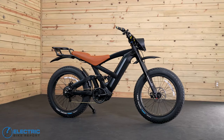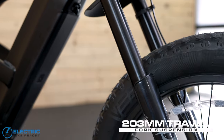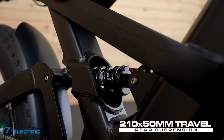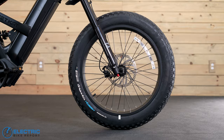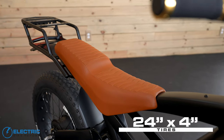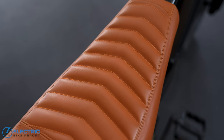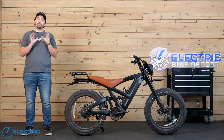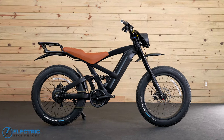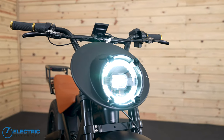First off, its comfort. There is a lot of spec here that adds up to a pretty nice riding experience. It has a full suspension design — there's an inverted KKE spring fork with a listed 203 millimeters of travel, a 210 by 50 millimeter rear suspension also from KKE, and you also get large tires with the V Mission Control 24 by 4 inch wide tire. Throw in the elongated saddle with two different riding positions, and you have what felt like a really comfortable experience — with the caveat of if you're tall enough to ride it. The Lynx comes in just one size, and I measured the lower part of the saddle at a 32 inch standover height. It also weighs over a hundred pounds, so it might not be the best for smaller and lighter riders, but the sizing felt really great to me.